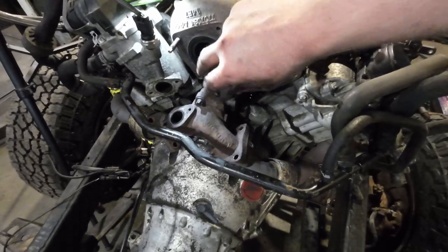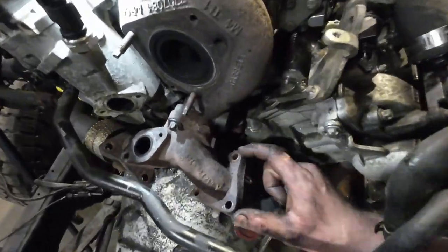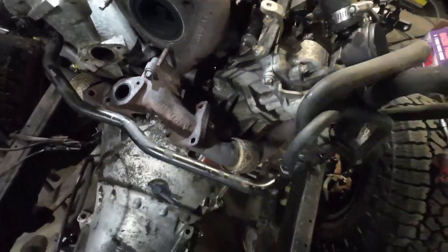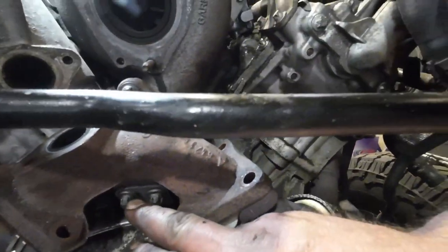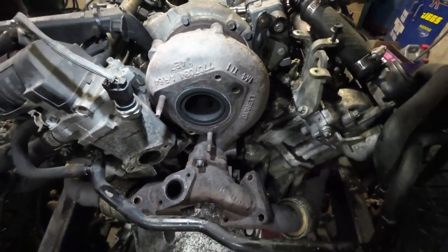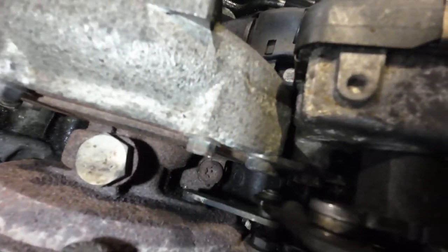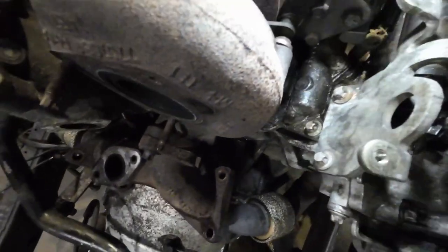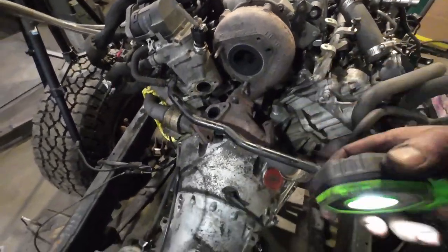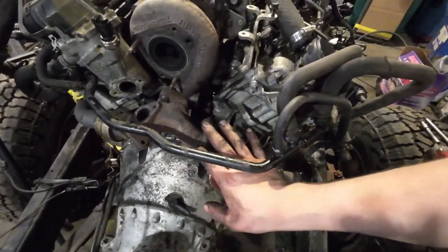First of all you have to take off the down pipe, then you have to take off the feed for the EGR valve which might not be going back on. Then you've got three bolts here for the up pipe, same on this side - three bolts for this up pipe. Then once you get all those out there's two bolts down here for the bracket that holds the up pipe. And then it looks like two torx bolts way down there, and then the turbo should lift off. Hopefully they come apart as good as the rest - Mercedes does a really good job with quality fasteners that actually come apart. So far everything's come apart without heat.